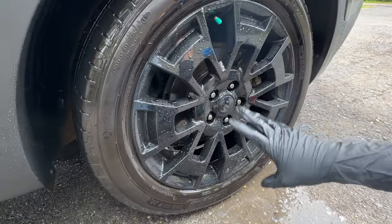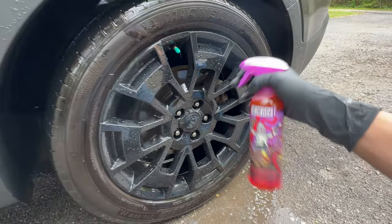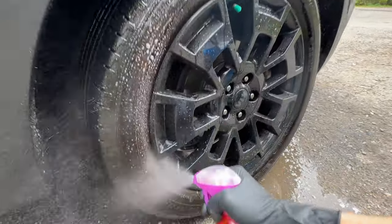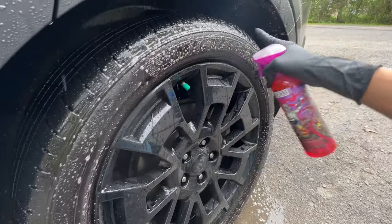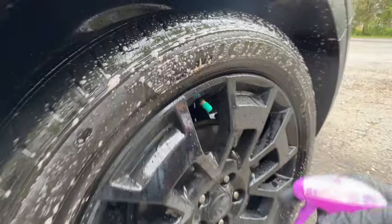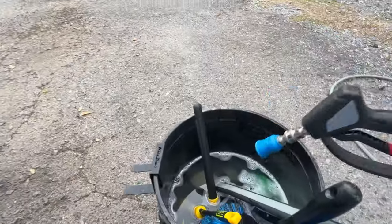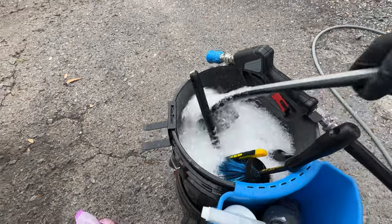Now we gave everything a rinse – everything should be cool to the touch. Now we get our Brimstone wheel and tire cleaner and spray it into our fender wells first, letting it start breaking down that stuck-on grime. Next, I like to do the tires – let it have some extra dwell time on these plastic fender liners and rubber tire. You can see it immediately start breaking down that grime and those old dressings. Then we put it on the wheels – the barrels and the face. I like to add a pH-neutral soap in our bucket to give everything a little extra lubrication.